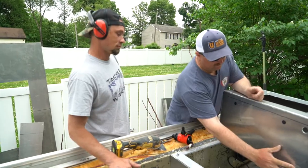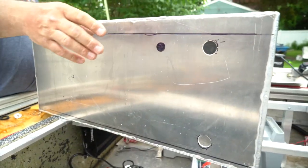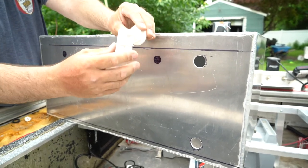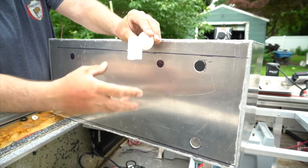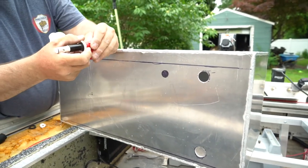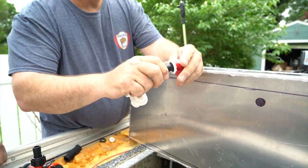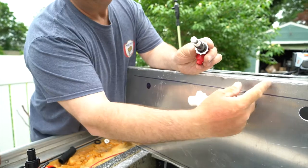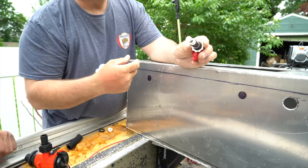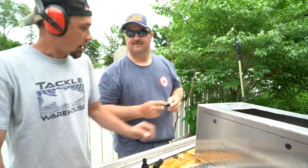This hole here is going to be for the pump. This is the one that's going to recirc up to this two-way valve. This valve works as a fill, a spray head, an aeration head, and it also works as a pump out. It has a little pull head on it. It's in a lot of bass boats too. I put them in a lot of aluminum boats, but you pull this out and it changes the flow direction the water's gonna go. It'll either be recirculating into here or it'll go out and pump out the back of the boat, which is where we're gonna put the pump out hole, so you can fill your live well bag when you're winning tournaments.